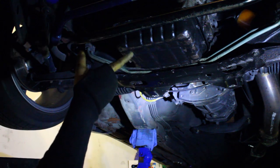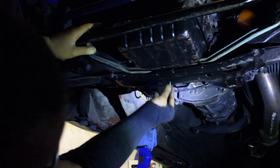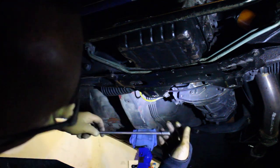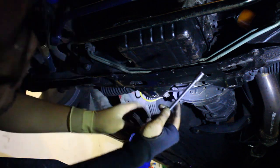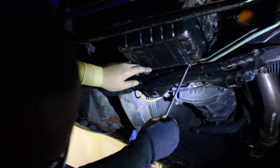The only potential thing I see that can give me trouble right now is being able to bolt the bolt up here. As you can see, it's a really tight fit. Your finger-tight one doesn't even fit, so I will work on that when it comes time to put the screws on. But this is what I used. It's a quarter inch extension. I was able to feed it through the oil pan as well as get the bolt, so I was able to do that.